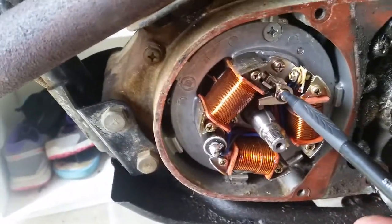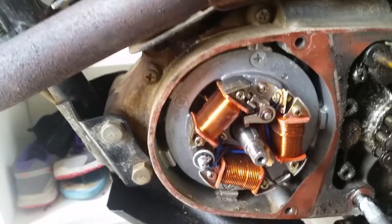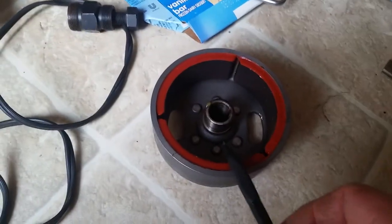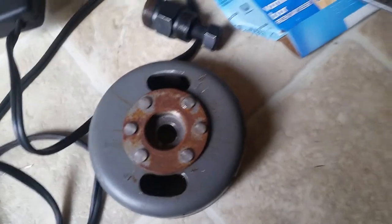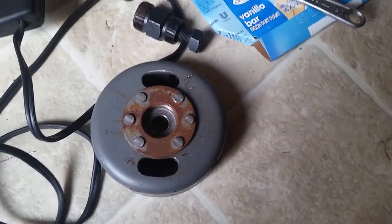Your points go right here — one screw. I'm going to show you the trick to gapping these, because you have to gap them and you can't gap them with the flywheel off. The flywheel has, on the back side, a cam drive — that's your window. There are two windows: one for adjusting the points, and one probably for balance.